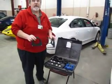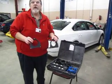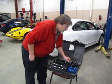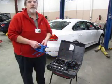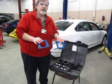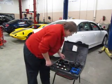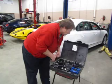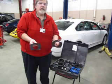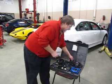We're going to be using the Chevrolet van with a standard set of headlamp aimers. These adapters are used on a 2 headlamp system using rectangular headlamps, and this is the set we're going to be using here. If you had a 4 headlamp system, rectangular, where you have a separate high beam, you'll be using the blue adapters. These would be used in order to mount on that particular style of vehicle. If you have a vehicle that has the General Motors mini quad headlamps, you will use these adapters here. Those were used on a number of General Motors SUV vehicles.